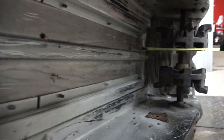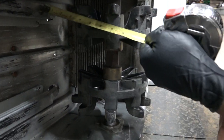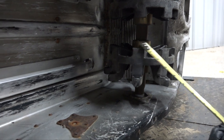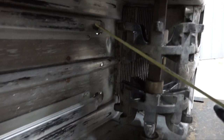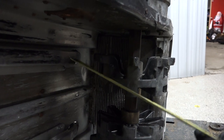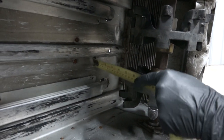I need to measure from the lowest point — not the highest point of the tunnel. You've got to clear the coolers, so I want to go to the lowest point, the part that hangs down. That's where I want to make my measurement. I need to make sure I can get just about three and a half inches of clearance.